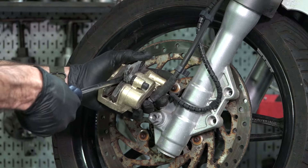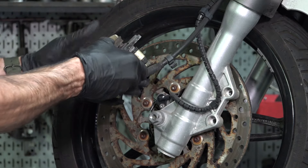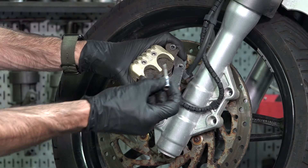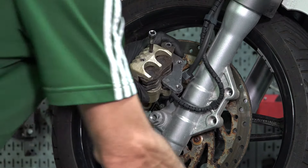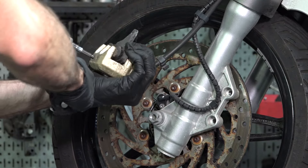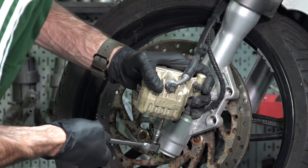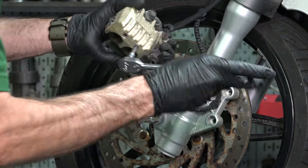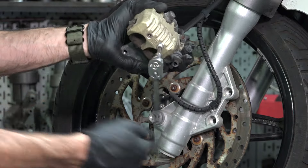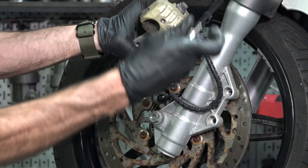Go ahead and stick a big flat screwdriver and you're pushing these pistons back into the brake right there. And there's a pair of Allen fasteners back here. You're going to take a five millimeter Allen key — it's kind of nice when you have a socket — and there's quite a bit of force on it. You may not be able to do this by hand. You could actually even leave the caliper bolted in place and get access to these screws from the backside through the wheel. You do have Loctite on them, sometimes corrosion. Let's go ahead and pull the pin out — the pair of them, they're both identical.